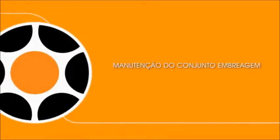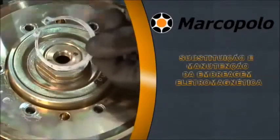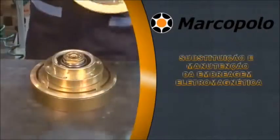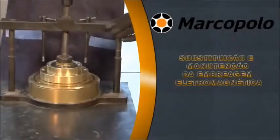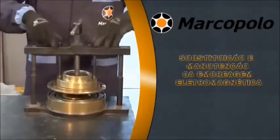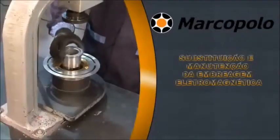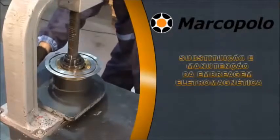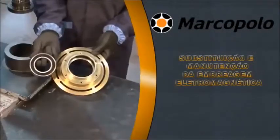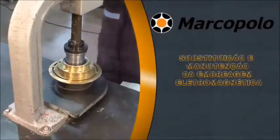Maintenance of the clutch assembly. Remove the pulley from the clutch assembly after opening all the bolts. Remove the snap ring from the bearing. Remove the set pulley using a special bench and separate it into two parts. Remove the snap ring and use a press to remove the bearing. Replace the bearing. Replace the snap ring and use a distance piece for support of the clutch assembly. Check the air gap of the assembly manually. Replace the bearing cover and snap ring, then rotate the clutch assembly and check that the pulley runs smoothly without any noise.